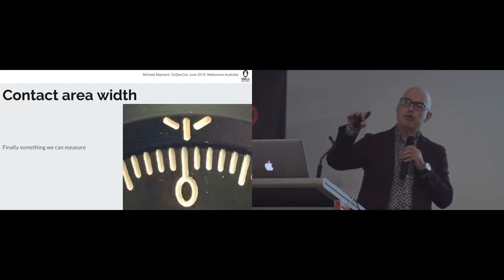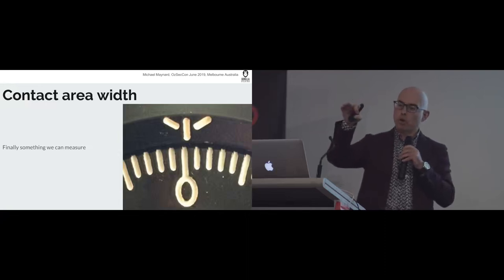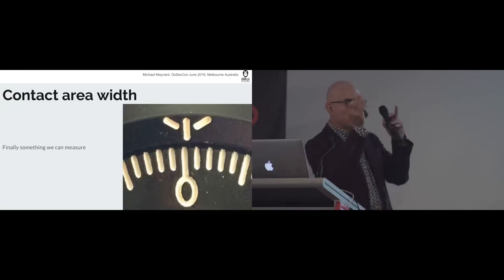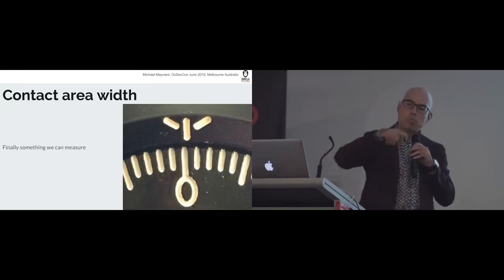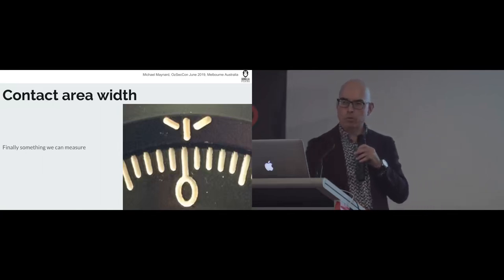So we might find that, for example, and I'm making numbers up here, most of the time a contact point was 1 on the dial. But maybe when we had the wheels in a certain position, it dropped down that little bit further, and so the contact point was lower, and so the funnel was lower, and so the contact point was less than 1. So it was kind of, I don't know, 0.3 or 0.4 or something. That would give us some data about where those wheels are. So once we've got that, what are we going to do about it?